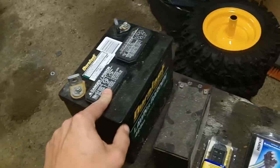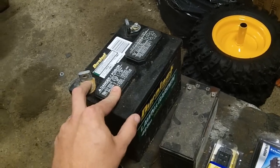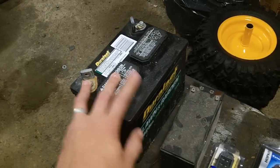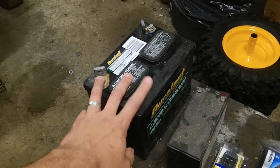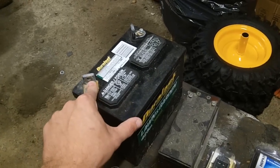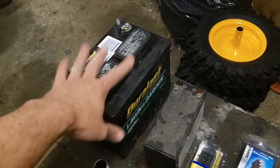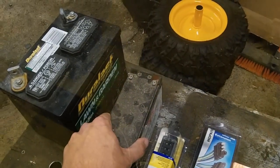We're switching over to sealed cell batteries. I've been running power wheels on these for years — actually on about my fifth year. The reality is they explode due to overcharging, not due to use. The last one I had in the Silverado ran for three summers perfectly fine. I use a really slow trickle charger and charge them overnight next to the garage while the kids are asleep. But we want to reduce weight, so we're going down to a smaller unit this time, which means we need to make connectors for it.